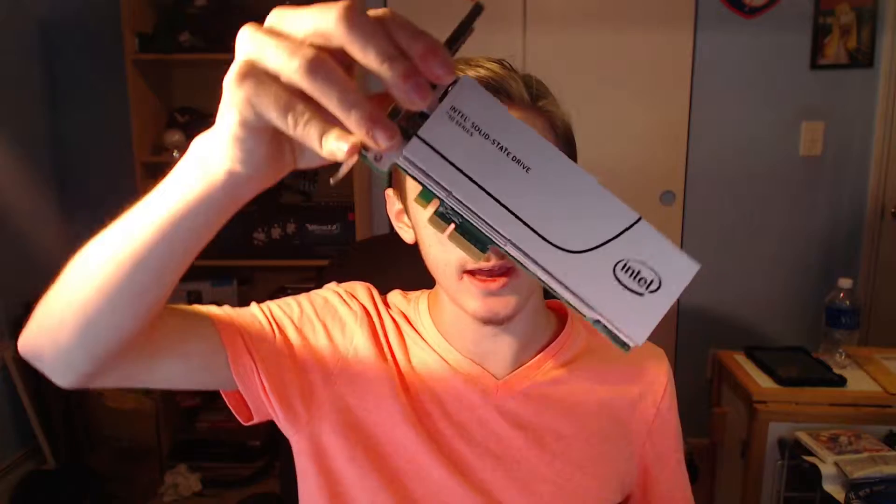Here's the asterisk — here's the catch. This is only supported on not even all Intel platforms, so older Intel users have to do their research on this. I think it only supports the latest Intel chipsets: Z97, X99, Z170. Don't quote me on that — that is something you need to research before you purchase. And on AMD, it's very sketchy. With AMD processors and AMD chipsets, you have to be very careful, because first of all, you're limited in speed to around 1.5 gigabytes per second — slower than what you paid for.